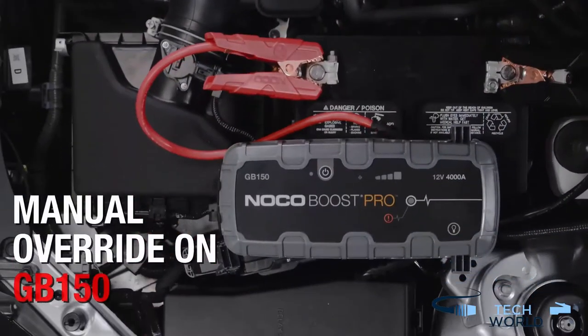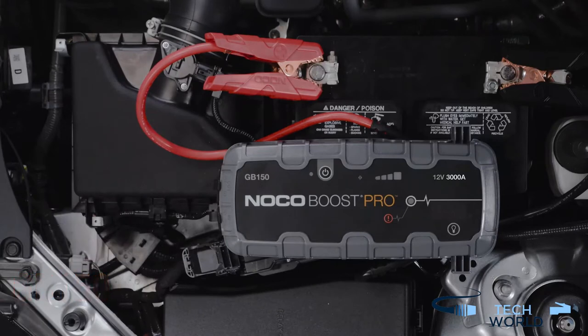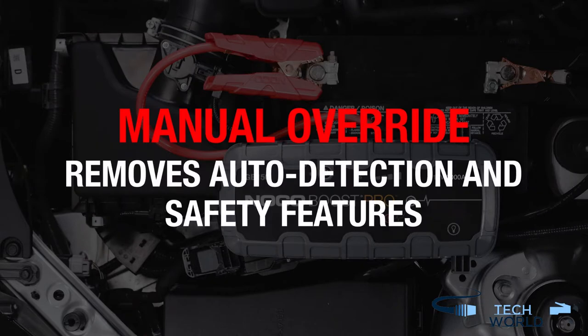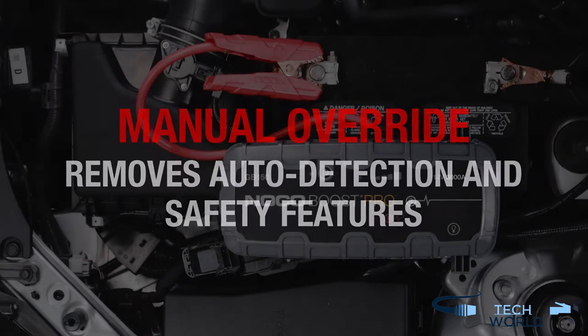Manual override is only needed on boost if the connected battery is too low to be detected, so it is important to understand when and how to use it properly. Note that manual override does not provide any additional power. It simply removes auto detection and safety features.